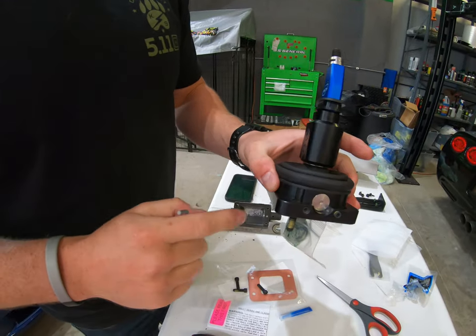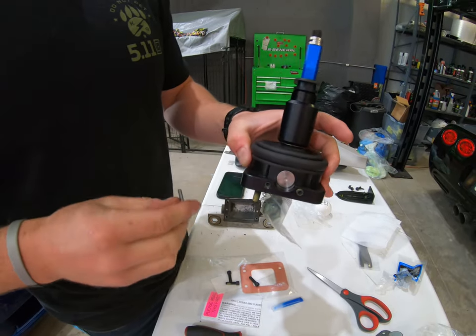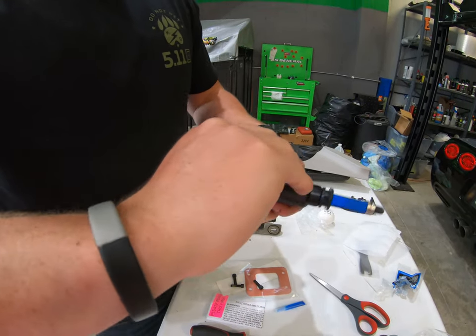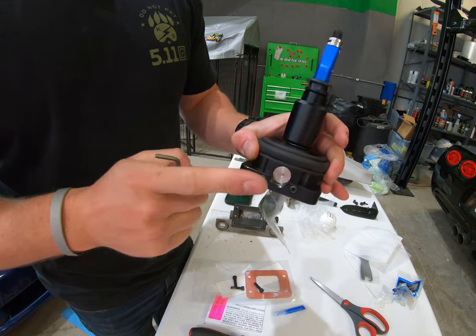So what you're going to want to do is while the upper shifter box is out, go ahead and put in a piece of the hardware. You're going to do it on all of them, but I'll show you on one. Put the hardware in, tighten the lock screw until it locks, and then you're just going to back it off so it's just loosened. This way, when it's in the car, it's easier to do it. Go ahead and do that on all of these, then we'll go ahead and install the upper box.